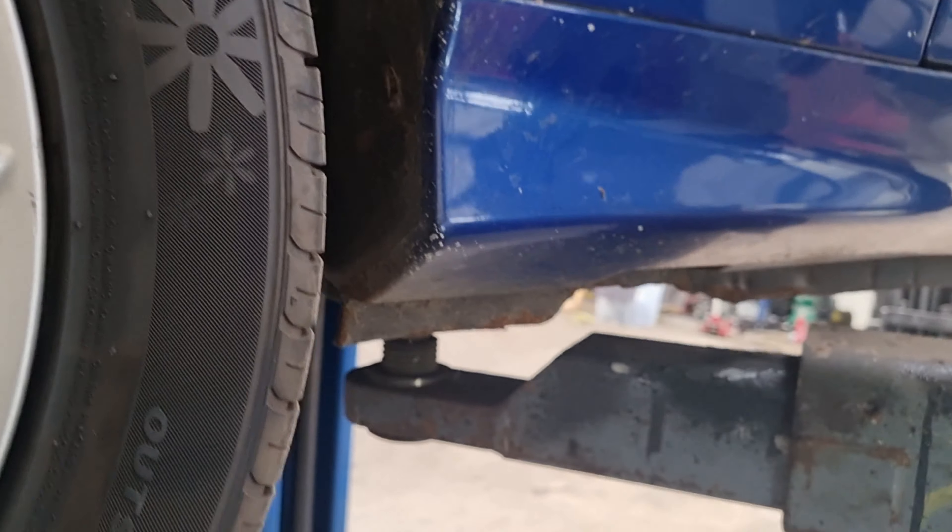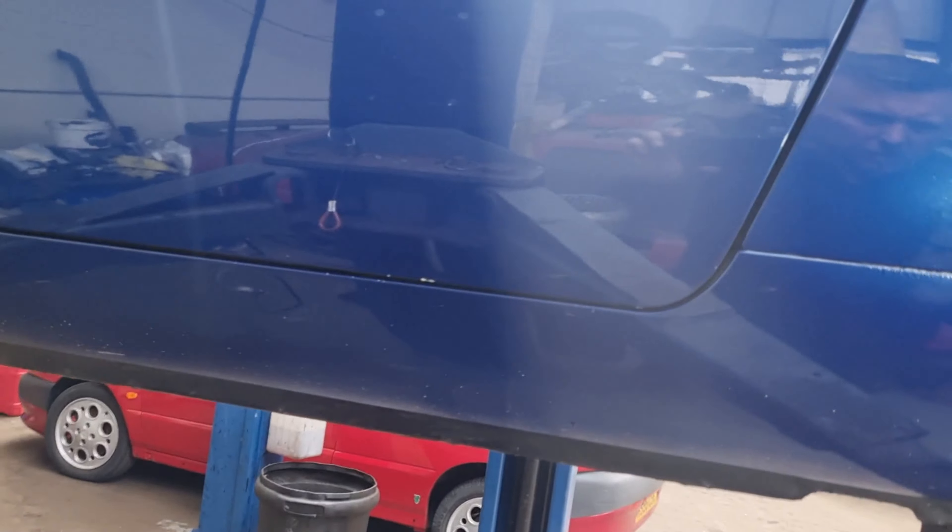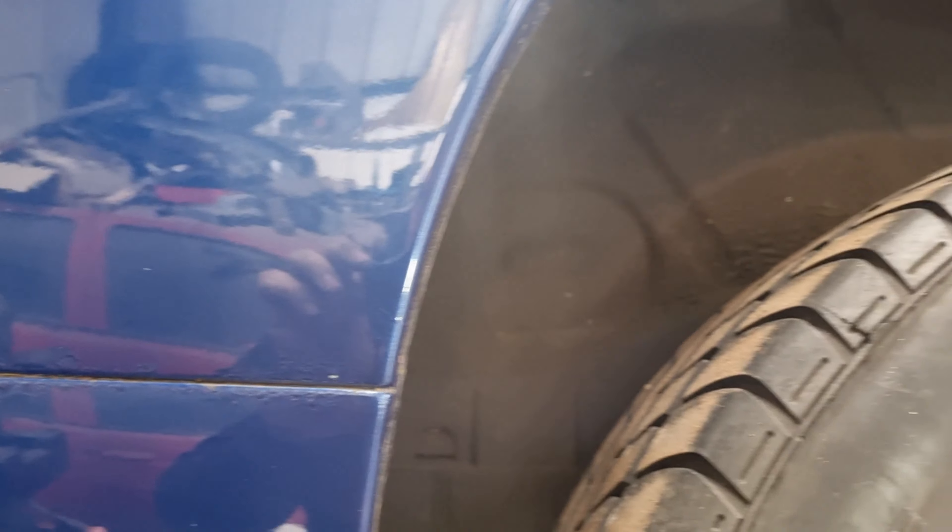The discs and pads — the pads, from what I can see, have about half the life left, but the discs have a really big lip on them. There's a bit of rust coming through underneath. I said earlier there was no rust there, but there is — it's starting to come through the seam here. And behind, there's a little bit of rust up there. Under the arch, there's a little bit coming through towards the back, but nothing major at all. That can be caught nice and early.